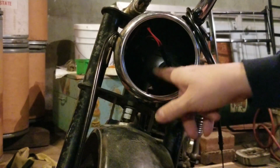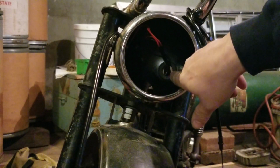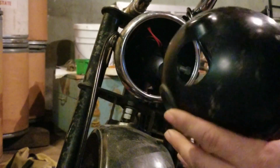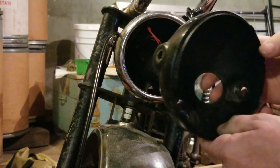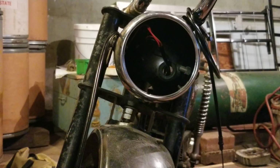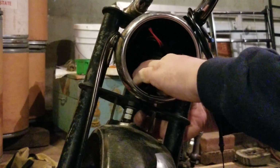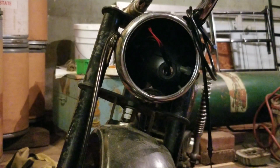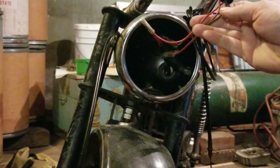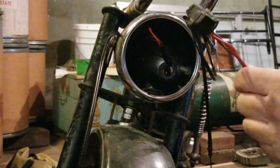The holes in the back are in the same spot, just that the KV75 has a smaller upper hole than the back of the G3. So the holes are in the same place: one dead smack in the bottom, and then the one up in the top. So they are basically the same, a little different. If you wanted to use the grommet in the bottom of your other one, you can, which is what I'm going to do. And they have this type of socket with the same color code as your bike has, factory. It's just on a pigtail that plugs into your bulb.